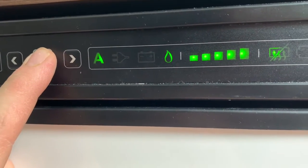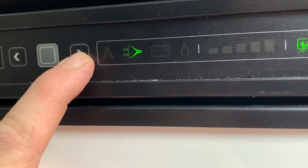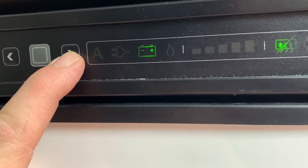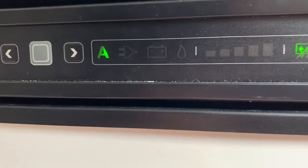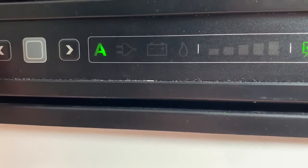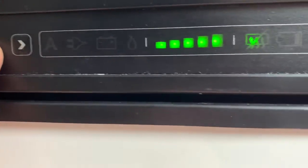To make it work, tap the gray button to wake things up — tap and hold — and it will flash. Then you can select: electric, battery, or gas. Back to automatic is best, because when you're driving the battery will power the fridge, and when you stop and plug in it will switch onto electricity. Select it by pressing that button.